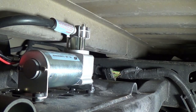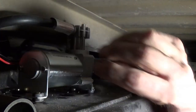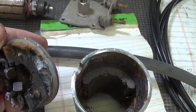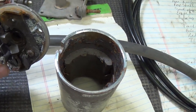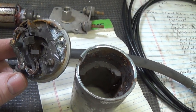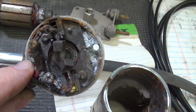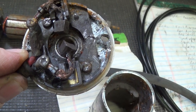Remember how exciting it was to install that little airlift airbag compressor in such a dry and secure location away from all sources of water? Well, there is no gasket on this motor end cap, so if any moisture gets close to it even in a high spot which is pretty well protected, this is what happens at the end of that.